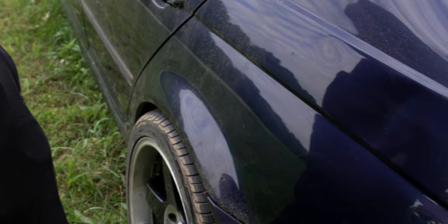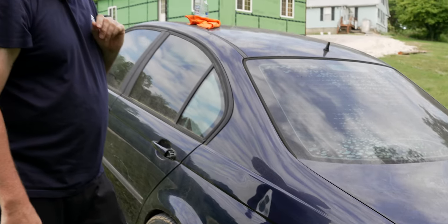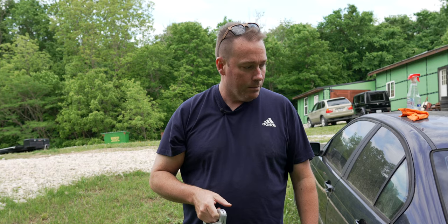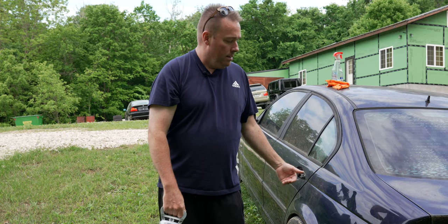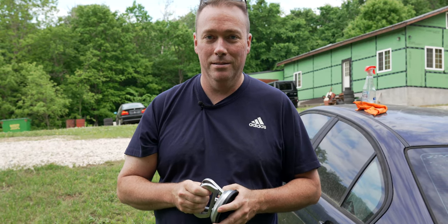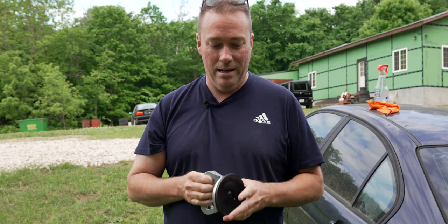They do make smaller ones of these — I actually have one somewhere and may do that video later. If you're just looking to pop dents out of a car, if your car is kind of a junker and you don't want to go to the body shop, or if you have a big overall dent, these will work pretty good. Also if it's on plastic, pour some boiling water on it to heat it up then pull it out. You can also get behind it and try to push it or beat it out. This is not a substitute for a body shop, but just a quick fix — if you're 16 and you crashed your mom's car and you're looking for a five-minute fix to make it look like she won't notice, it's worth 10 or 12 bucks to get a suction cup from Harbor Freight, Amazon, or wherever you want.